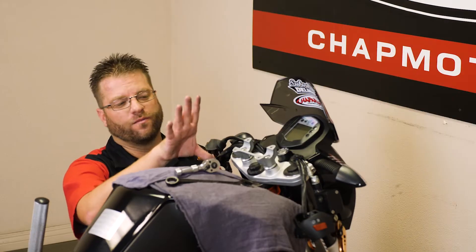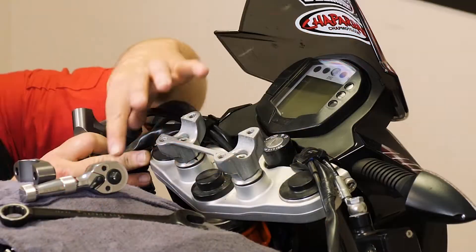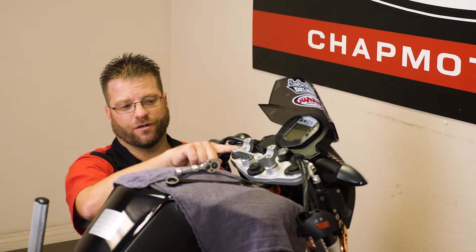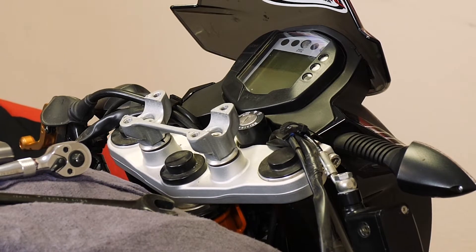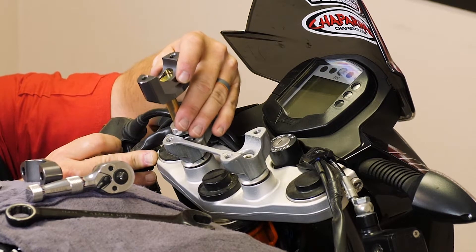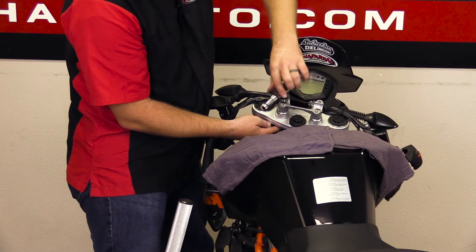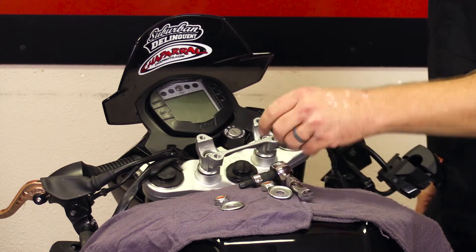Now that we're here ready to remove the OEM risers, we want to take a look at positioning. You can see that the center of the bolt is right here in the center of the triple clamp hole. These risers are currently set for the bar to be fitting a little bit further forward — you can see that the bolt in the center is a little bit offset. If this rider wanted, he could flip this clamp around and have the bar sit a little bit closer to him. The same situation is going to happen with our Zeta risers, so we want to make sure we have them set up the way this rider wants. Now let's get the stock riser clamp removed — pay attention to how it comes apart so you can make sure it goes back together in the same order and fashion.